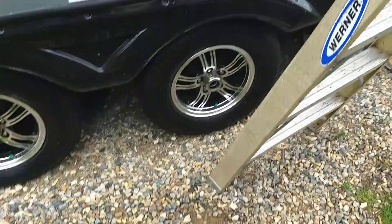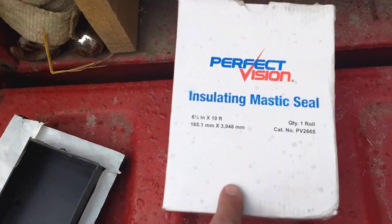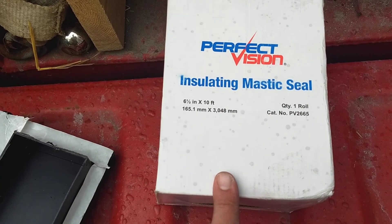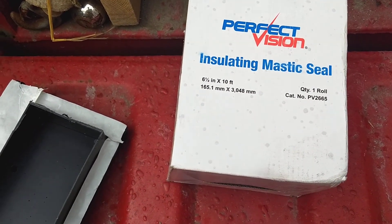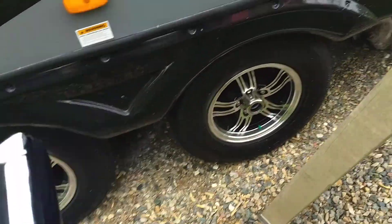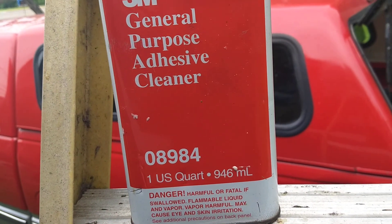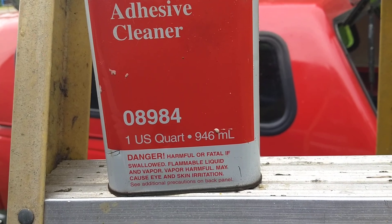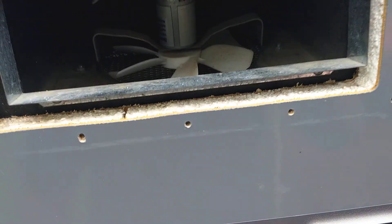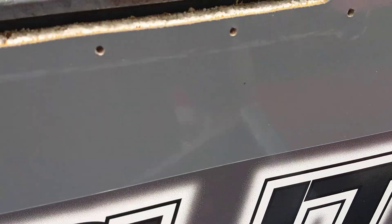Let's go over and look at the hole and see how she fits. I put the mastic tape on the back instead of a bunch of silicone. This is the product I use — it's awesome stuff. If you're doing anything with camping, look to get some mastic seal like that. It's sticky and it seals up everything and you don't have that ugly piece of silicone. This general adhesive cleaner is what I use to get the silicone off. And I have a clean hole. The lady at the shop said the screw holes might not line up, but I'm not too worried about that because I'm sealing it with mastic tape.